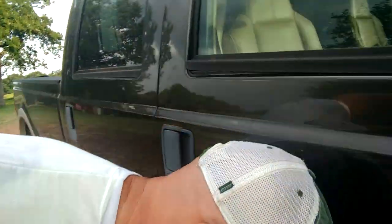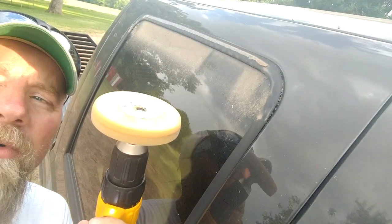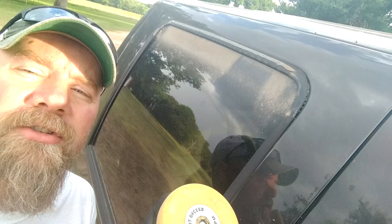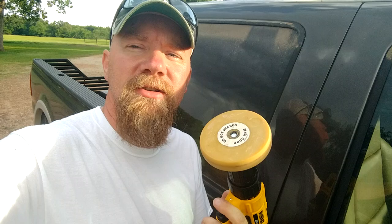One of the easiest things I've found is an eraser wheel. It will not damage the rubber at all. If you look right here on this corner, I've already done a little section there — I've already done the driver's side of the truck. This eraser wheel won't damage that rubber. Just be careful, don't get on the paint too much. I have used it to remove old pinstriping, and if you're real careful it won't damage the clear coat. This is an item used by body shops anyway. So fishing line to get back behind there and saw through that two-sided tape, and then an eraser wheel — makes the job pretty easy. Thanks for watching.